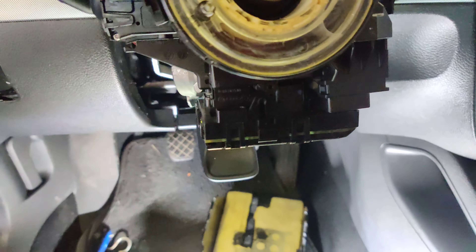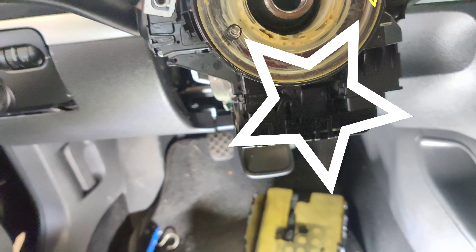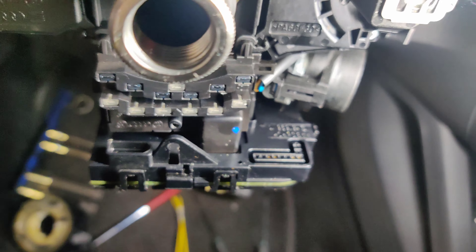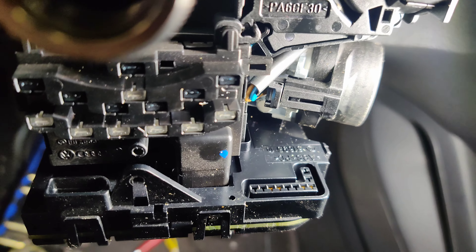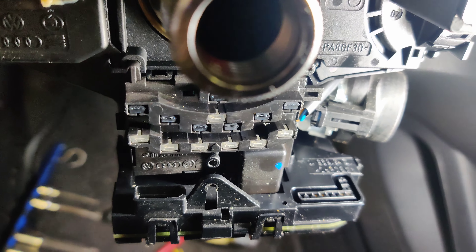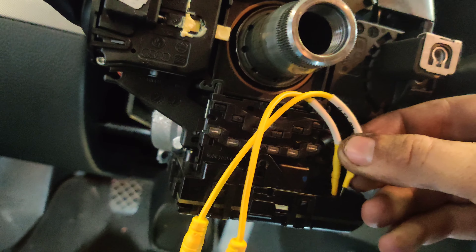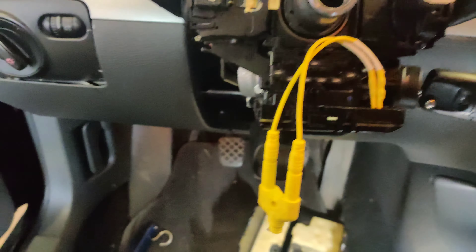So we got a bad airbag. And I think I found the resistance - I think they said it was like 3.4 to 5 ohms supposed to be for the airbag. That's what I found online just looking around. I couldn't find it anywhere in repair information - I even went back to like a 2004 Audi. So it needs a clock spring for sure. I guess we'll go from there because this goes right into the steering column module right here. I'll have to do a little bit more research before I put this back together.